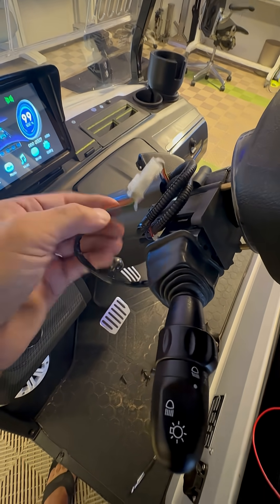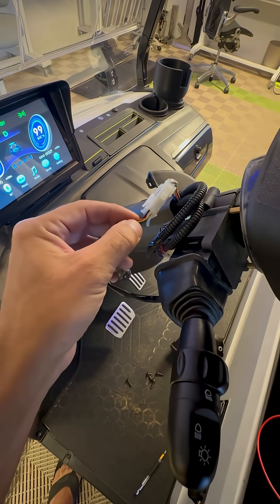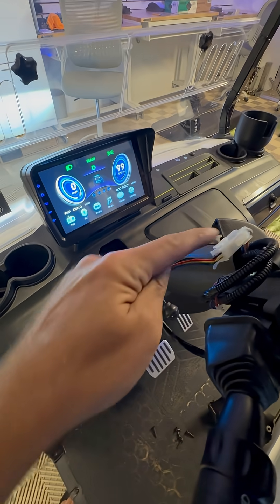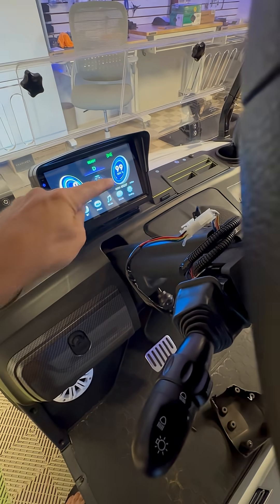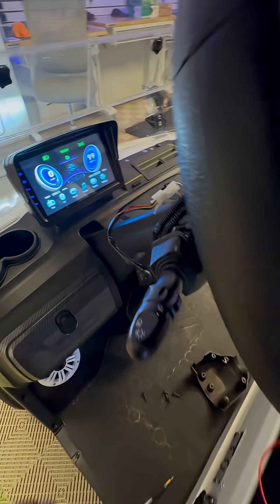The yellow wire is the pass-through for the first notch here and the red wire acts as the second notch here. So you can see when I have it plugged in and everything's working correctly — first notch, my little light comes on that shows me my tail lights are working; second notch, I have the headlight beam.